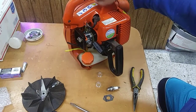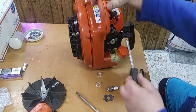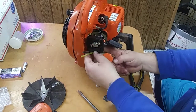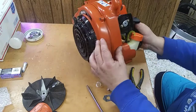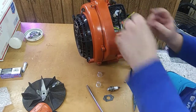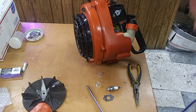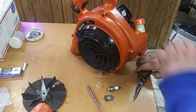Okay, so now that we got that throttle hooked up, just gonna replace my screws before it comes loose again, and that should hold it all together. With the carburetor being on and the handle being tight, it shouldn't have enough play to move now. Alright, so our throttle is working — that's a good sign. Now before we put this on, just gonna snug these up. Now we're gonna attach our fuel lines; we already got our vent up in here. This is the fuel draw and the primer bulb return — we're just gonna attach those underneath.